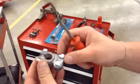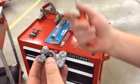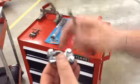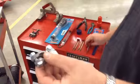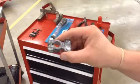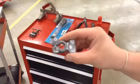And when they do that, they're actually damaging the battery, okay? Because that terminal is made out of lead. So is our contact. It's made out of lead also. But when you pry between the battery's plastic case and trying to get this terminal off, you usually wind up either cracking the case or dislodging either positive or negative terminal, and it's going to break loose from the plates inside, and now the battery doesn't work at all.